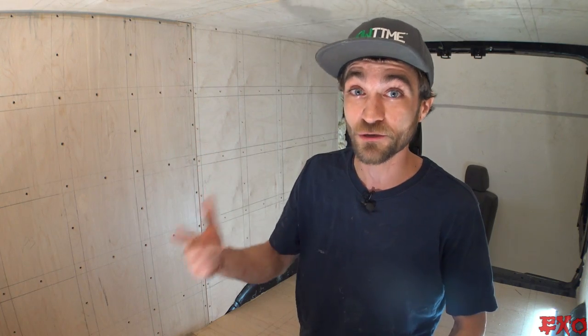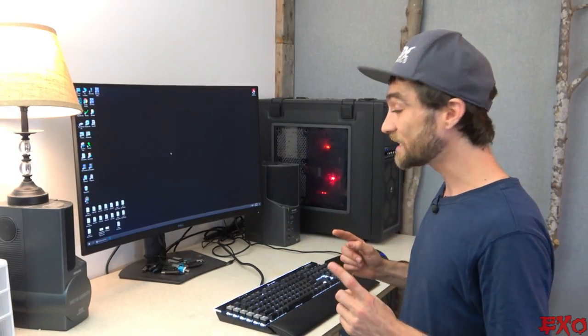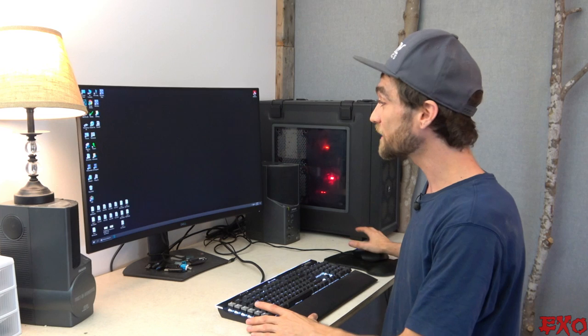A single reflex bandpass may be louder for certain SPL formats, but a series tune bandpass tends to dig a bit deeper and run a bit cooler how I like. That type of baffle would also lay out side to side and floor to ceiling. We just need to find a way to impose that size of a rectangle onto today's video screen.